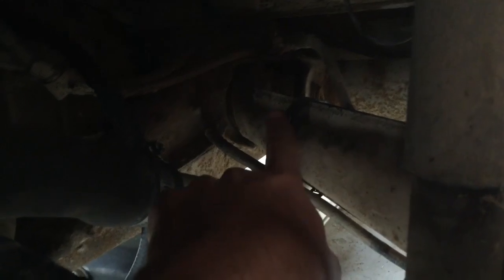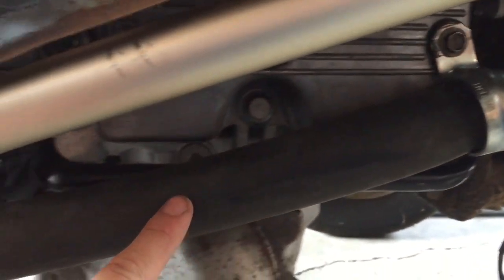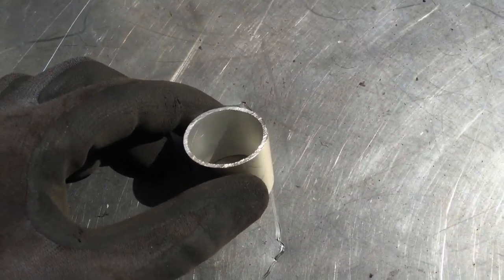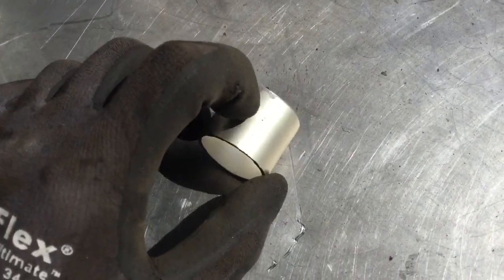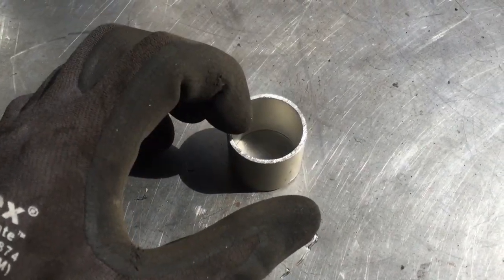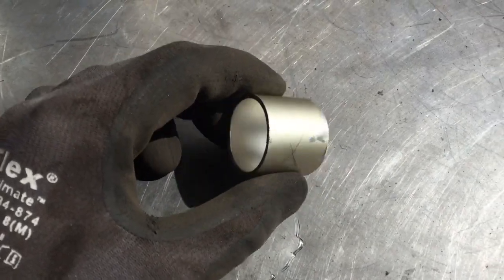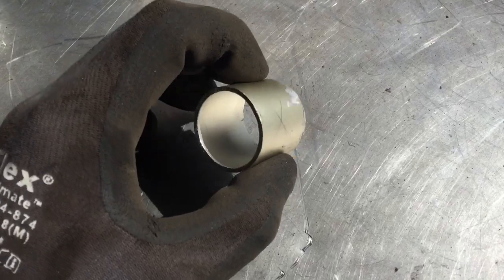This is doing nothing right now — it's just for the emergency brake cable, so I'm going to be taking that off. It comes up here with a little clamp holding it on and swings into the thermostat via a little coupler. Here's a cross-section of the coolant tubing I used — it's got a slight gold finish, an inch and an eighth internal diameter, inch and a quarter outside diameter. It's a form of aluminum, bends really easy, pretty strong, and pretty lightweight.